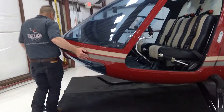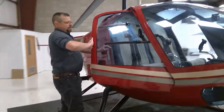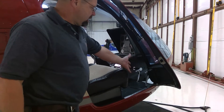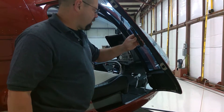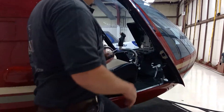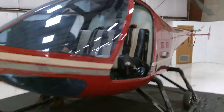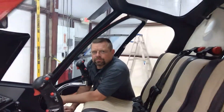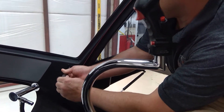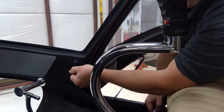Let's walk through a removal. We'll look through the inside of the cabin. The first thing we'll do is open the door. We're going to remove the hydraulic ram that holds the door open and the strap that keeps it from going open too far. The first step is to remove this Phillips screw — that's the strap that protects the door from overextending the ram.